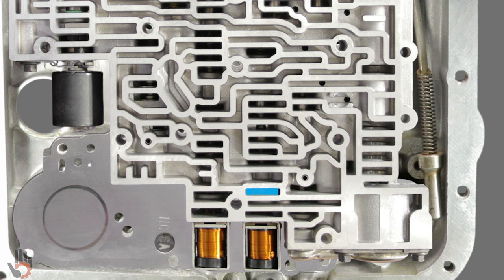This video is all about the 1-2 shift valve and the 1-2 shift solenoid. In order for this valve train to function as intended, it must receive oil to this portion of the valve body. Looking at the valve body, it looks as though the oil has appeared out of nowhere, and that's definitely not the case. In this segment, we're going to be covering how the oil flows from the oil pan all the way over to our valve train.